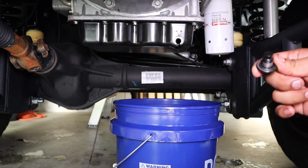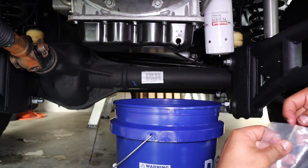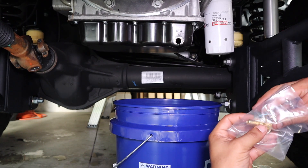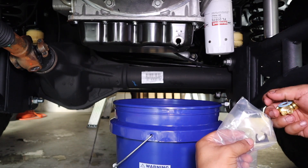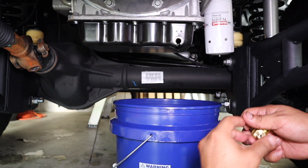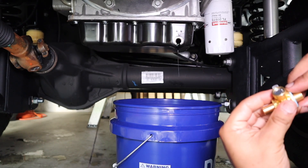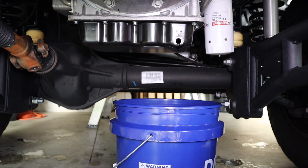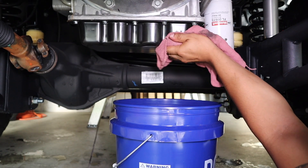I took off the stock oil drain plug. I'm going to send an oil analysis kit to figure out how this truck's doing at 4,000 miles. The stock drain bolt was 16mm; this Fumoto valve is 17mm, as mentioned. I'll put links to all the tools required in the description. Next step is installing the Fumoto and then taking off the oil filter to finish that portion.